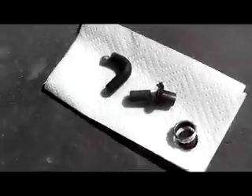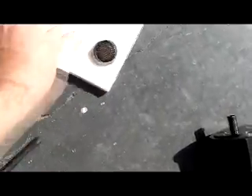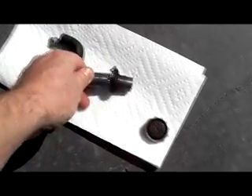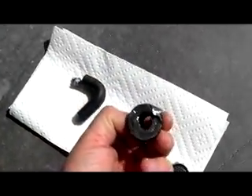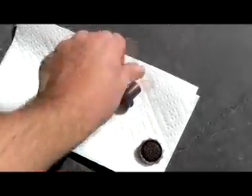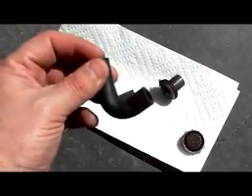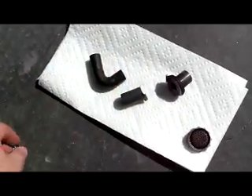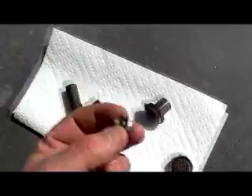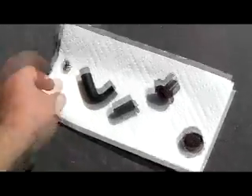As far as parts off the bike: this is the diffuser that was on the back of the exhaust pipe. This is the restrictor that was inside of the pipe — see how it cuts down through the center of it? You'll see on the other videos how we did the pipe. There's the two layers. This was the little hose that got replaced from the Bly Racing kit — one half goes on to the carburetor where the block-off went on to the new block-off screw, and the other half went on to the T of the vent hoses from the crankcase in the engine. This little screw with the O-ring on it came off of the catch can on the bottom of the bike, and you don't want to keep that on because it'll accumulate gas and get sucked into the engine.